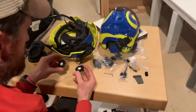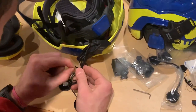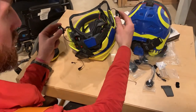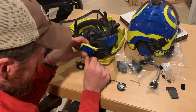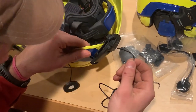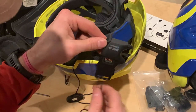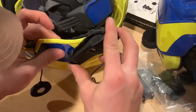Next we're going to do the speakers — they are hardwired into the receiver unit. You'll have a long wire and a short wire, so obviously your short wire should go to your closer muff and the longer wire should go farther away. Another thing I like to do — which I totally forgot to do — is to route this long wire underneath and in between there. So we're going to pause the video again, take the screws out, unwiggle it, take the long wire, tuck it underneath, and then force that sucker back in there.